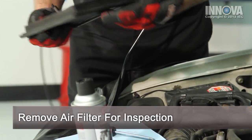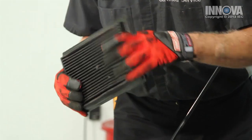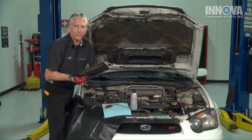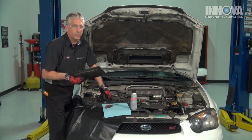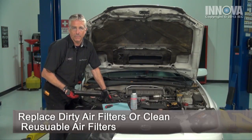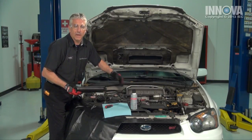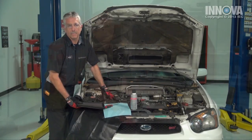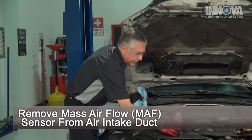We found a restricted air filter. This may not seem like much of a problem, but it's going to restrict the air flow into the mass air flow sensor. We could also have some particles pass through and get onto the sensor itself. So let's clean the filter and check the sensor using an approved cleaner, and clean up that mass air flow sensor nicely so that we can start anew.